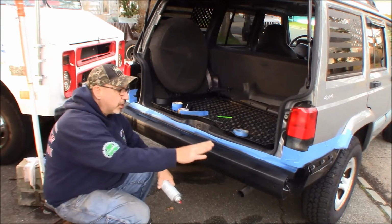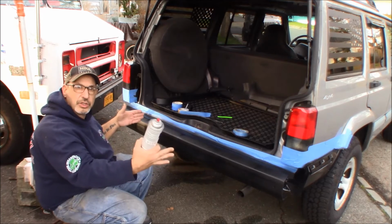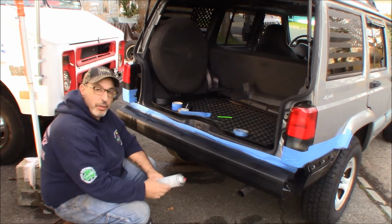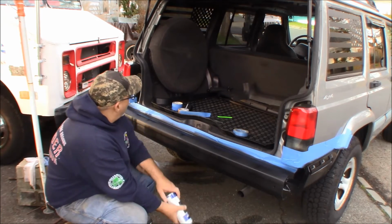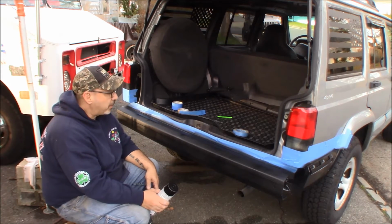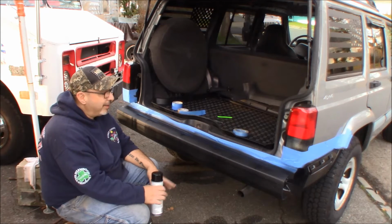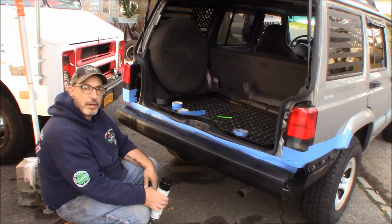Alright, so I gave it a decent coating on the bumper with the rust encapsulator. I did 2 coats on the side pieces because they're not getting anything other than the new refinished side pieces being put on them. So, clear out that tip. Let this set up for about 10-15 minutes, maybe a half cup of coffee, and then I can put some bed liner on it. Bed liner's only going on the back. I just got to put some cardboard, I might even tape some.